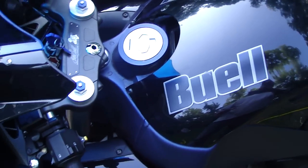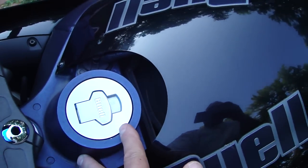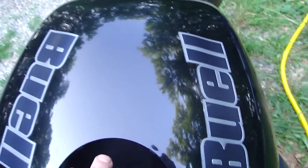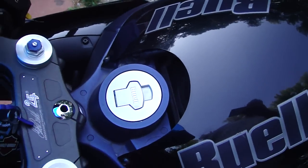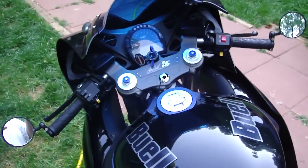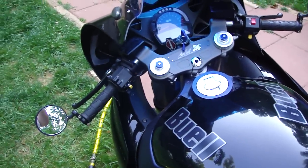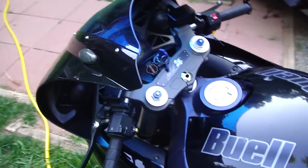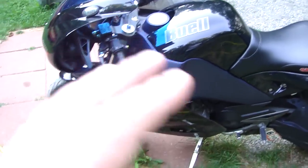The last thing I did was remove the inner air box cover and the trim ring that goes around the filler neck. I have a K&N air filter in there. What this does is break up some of the reflective harmonic inside the air box — with it open, the harmonic comes blasting out and it's very loud at wide open throttle, almost ear-shattering. But at normal riding speeds through traffic, it gives you the ability to ride around at 4,000 RPM without the bike feeling flat and sluggish. When you roll on the throttle at 4 grand, it just pulls. You can ride in a higher gear, save fuel, and use the low-end torque that's lacking with the factory air box and ECM.